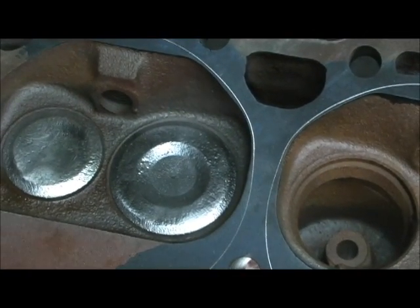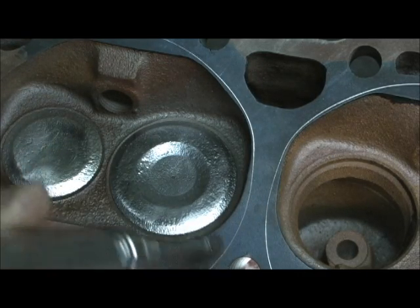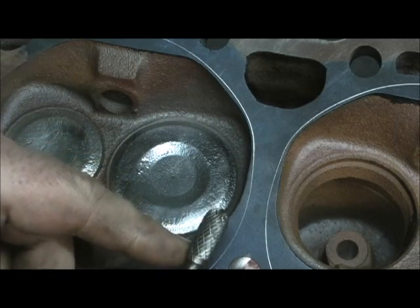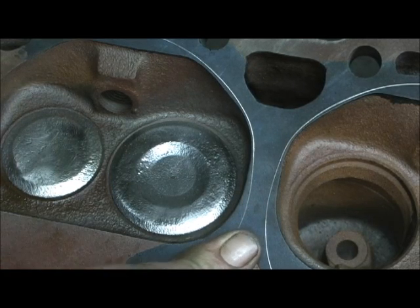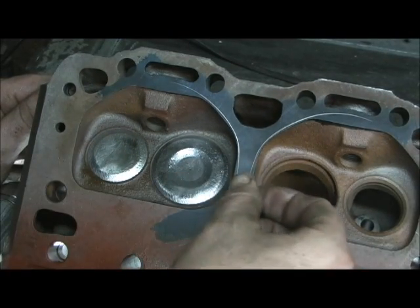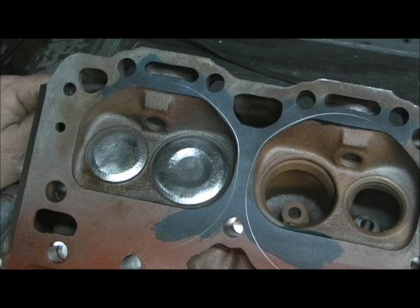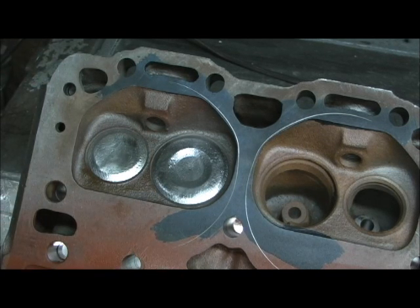After a little consideration, this is what I've come up with. I'm going to start here and go inward — I'm not going to dig downward, but I'm going to come in and bring my swoop to here. I'm using a cylinder with a rounded end, and I'm going to dig this out and pull into here to unshroud it so I can keep the curtain. It'll have its contour, but I'm going to pull this over to the line right about here because I just don't believe the curtain is helping this situation any. So let me go ahead and start.